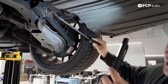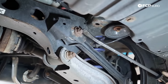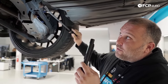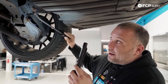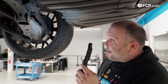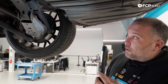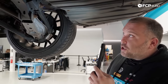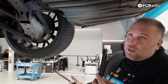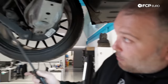These eccentric bolts are extremely crusty — I wouldn't be shocked if this was seized. It's a common problem in the Rust Belt states. Up here in Connecticut, it's not uncommon for these to be completely seized up inside the bushing in this arm. These arms will be entirely replaced strictly because of that. Looking at these control arms, they're all original to the car. You'll typically get bushing wear on these after some period of time, and in my experience the most weak link in the rear suspension is going to be this trailing arm right here.